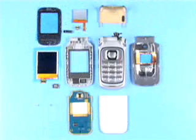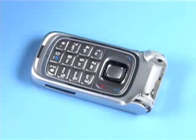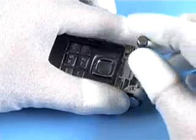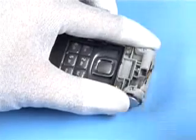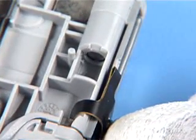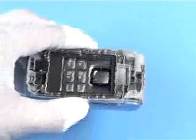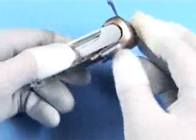The disassembly procedure is now completed. Assembly: Place the cover upper assembly after locking the hinge as shown — mind the flex foil. Now expand the hinge module by removing the tool. Ensure that the hinge expands completely before going on. Place the antenna cap and click it into its place.